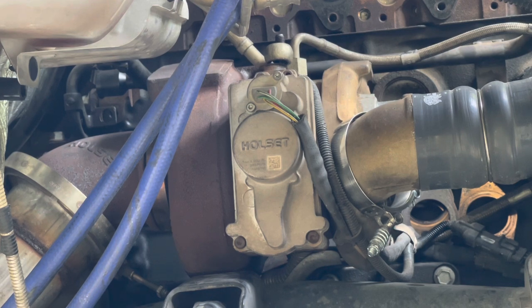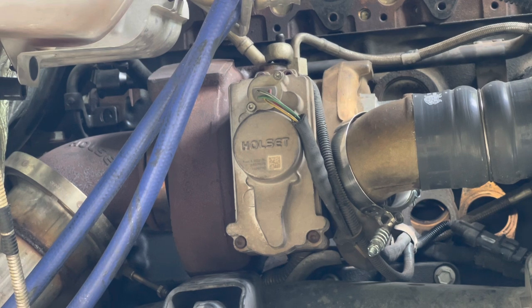This one in particular - we know it's not the actuator because we do have turbo brake and it's fine. What happens is when this turbo is warm and you're in gear on the highway hauling something and you use the turbo brake, it likes to get stuck in the closed position. If you let up off the pedal quickly, the vanes get stuck in the closed housing, making the turbo effectively very small. At high RPM - around 2500-2600 RPM, which is decent if you're pulling a trailer - you get all types of black smoke shooting out the back.